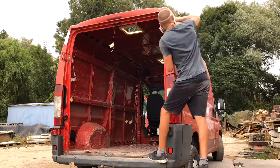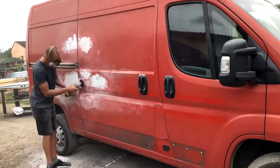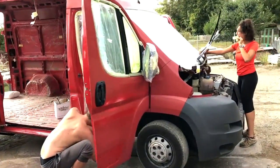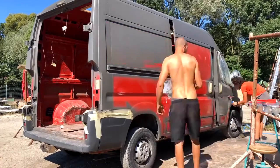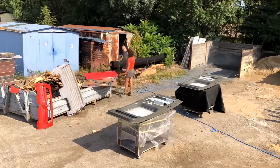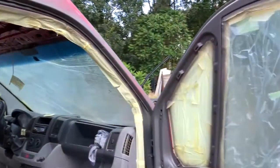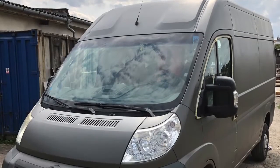This I believe is skippable for most people — it's a paint job. First I did some body filler to fix imperfections. Second I ran around the car with fine sandpaper and sanded down some loose paint and rust. Third I washed and degreased the entire surface. I decided to just roll the paint on our van. It's the cheapest and fastest possible way. I spray painted all curves first so I don't see brush strokes — that means doors from inside, roof, and just curves all around. After this I do two coats. The result is pretty good and I don't stress about scratching the car at all — if I do I can anytime do another coat for a few dollars.